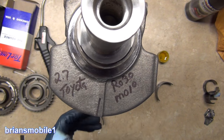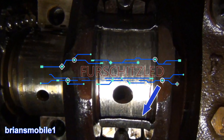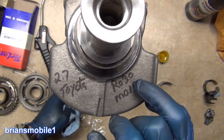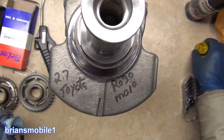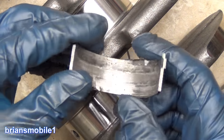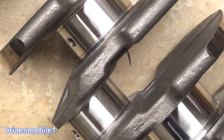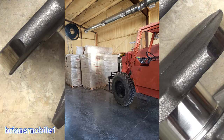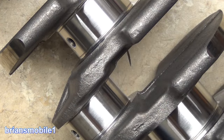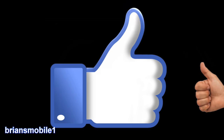Number one cylinder's connecting rod bearing seat was obviously jacked up — that's why they had to go 30 under. When the oil breaks down and they do touch, the result is what you saw on those damaged bearings. There's no rollers, nothing like that — it's just that film of oil the thing is riding on. All that pressure against the oil, but the oil can take it — look at hydraulic fluid supporting thousands of pounds, like on my telehandler. If you haven't seen the engine build series on that Perkins diesel you ought to check that out. Never underestimate the power of a liquid to support solids. Thanks for watching — be sure to click like and subscribe. Bonus footage at the end.